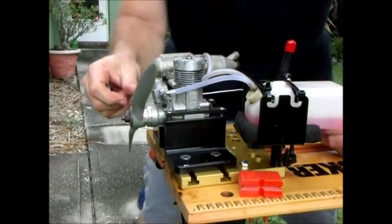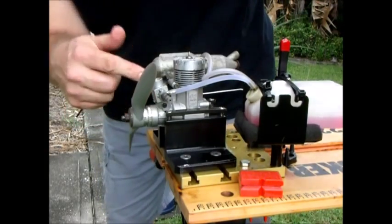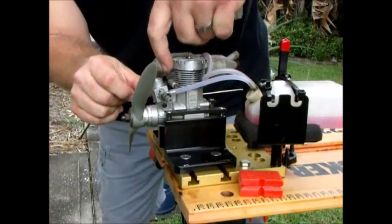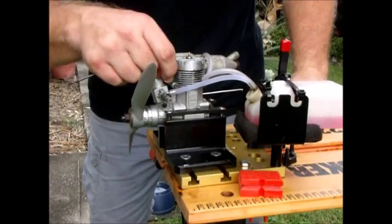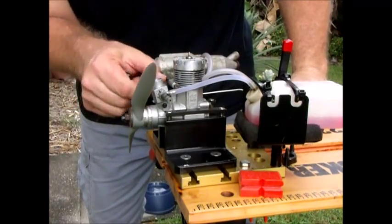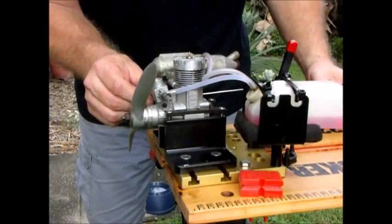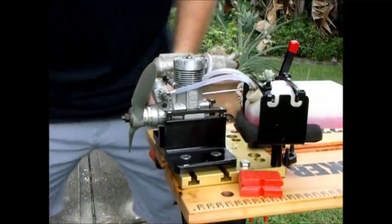One of the things I'm seeing with this engine is there's a spring in there. One of the things I didn't mention was that this throttle stop holder is broken — only half the threads are in there to hold this screw in place. That's what's allowing this thing to move in and out like that. Without a replacement, I don't think we're ever going to really get this thing to idle down, because as soon as I go to adjust it there's just too much play in this throttle and you can see that thing moving.